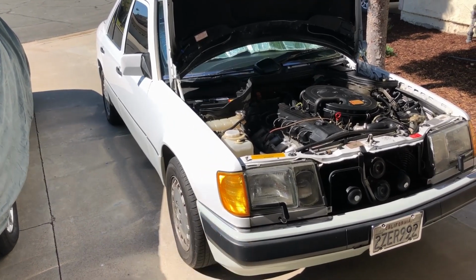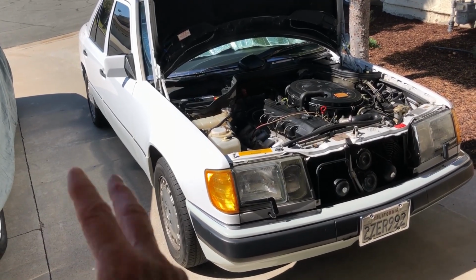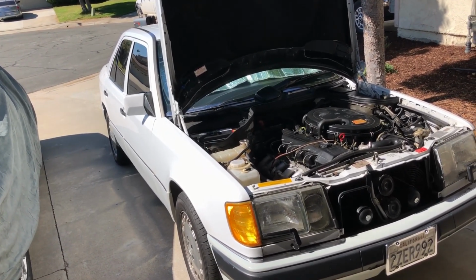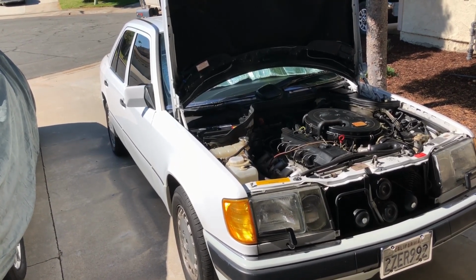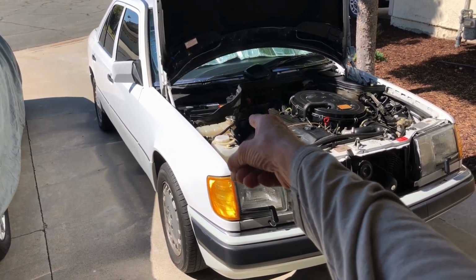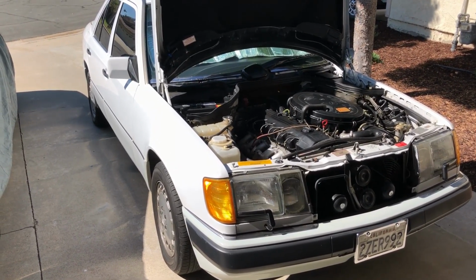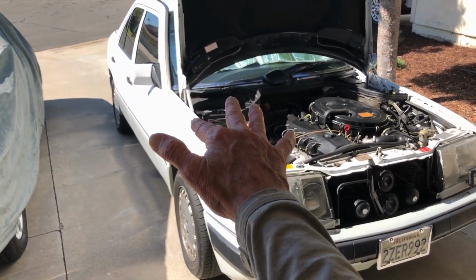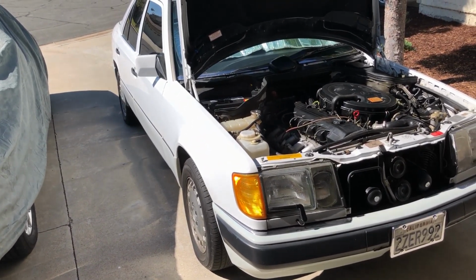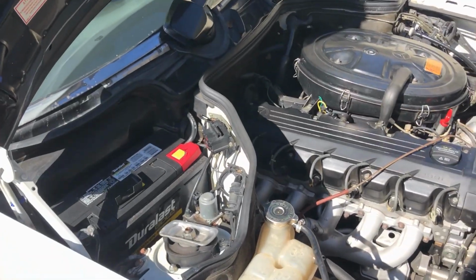Wow, I am stoked. So now I'm going to solder that back together. I'm going to leave that manual switch override. I'm going to try a couple different things. But this way, before the coolant sensor, that 2-pin for 10 years, it was doing nothing. Now, I should still start the car and see if all the air conditioning functions work. I think they do. If the high-speed fan turned on like that, I am totally happy. Okay, now I'm going to try my switch.